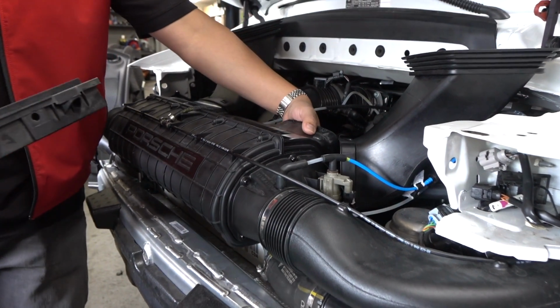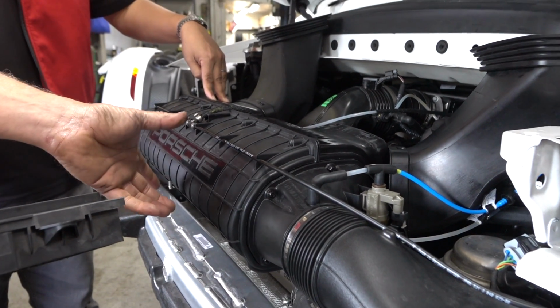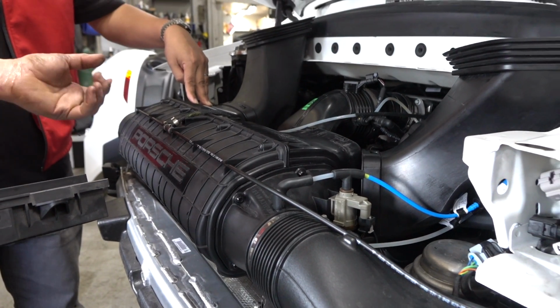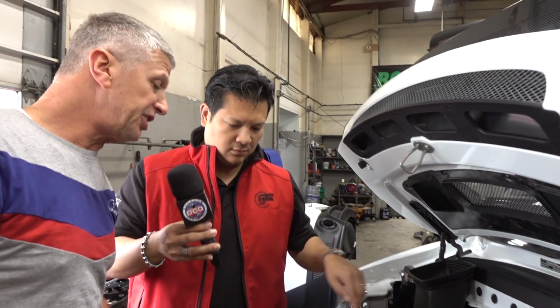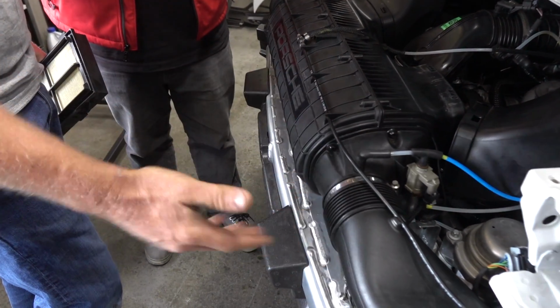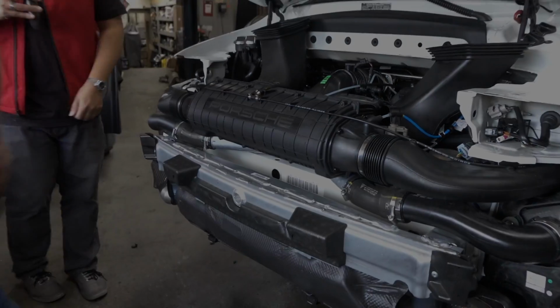There are. There's 3 tubes that run horizontally from turbo inlet to turbo inlet. And these are like a fiberglass composite. And what they do is they take out the larger particulates and stop those from being ingested into the cold side of the turbo. Really an ingenious, incredible entry system to the turbo. And you can even see the attention to ductwork. They've left nothing undone on the GT2. This is a pure race car at this point. All right, well, let's check out the race components that are underneath of this car.